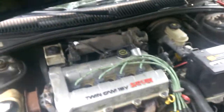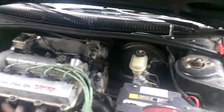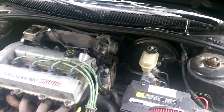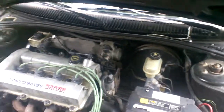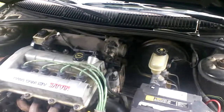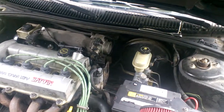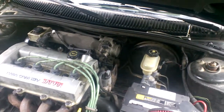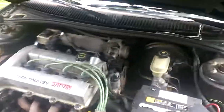We got a nice, healthy, smooth running engine, but you will have to do an idle learn. I'm not going to sit here and let it do the idle learn in the video because that takes about 30 minutes — an OBD1 idle learn. You have to idle the engine until the cooling fan kicks on and cools the engine to where it automatically kicks off by the ECM. You cannot hit the throttle at any time, you can't run any of your accessories. You just let it idle and the computer will calibrate the air-fuel ratios for you.